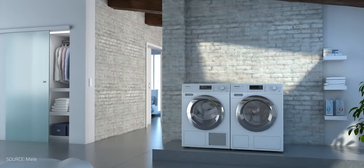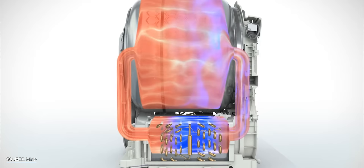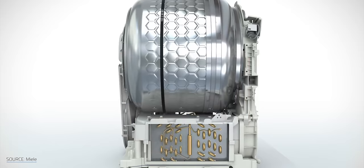The way heat pump dryers work is kind of ingenious. It's essentially a closed loop system made up of two circuits. One of those circuits is the air circuit that helps to dry the clothes. The second circuit is the coolant circuit that extracts the heat and moisture from the processed air. A heat pump uses a compressor to generate heat, and when you compress a fluid running through the system, that fluid is heated up. If you run that heated fluid through a radiator with cooler air passing through it, you'll heat the air. That's the first step of this heat pump dryer.